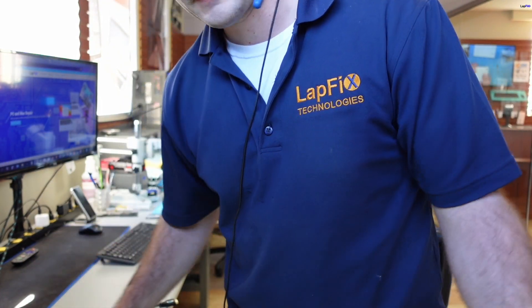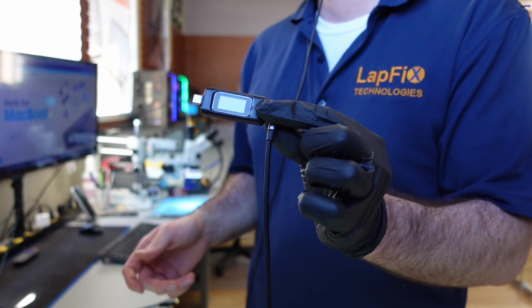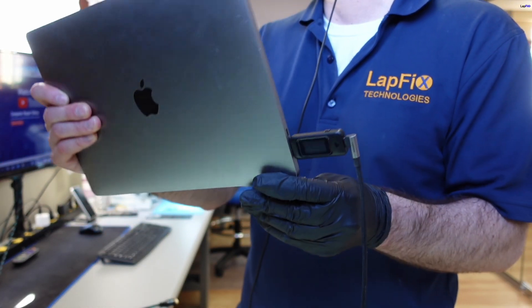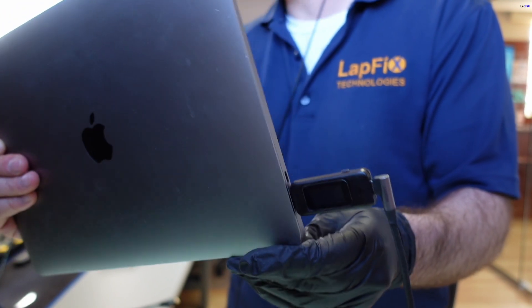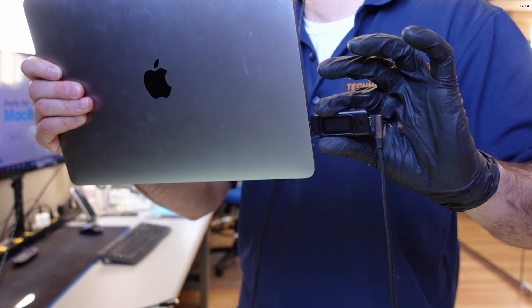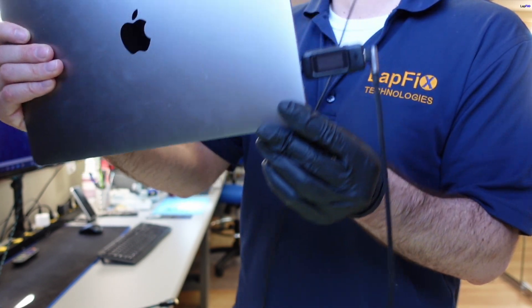I know there's a liquid spill but let's check the voltmeter real quick. I got this weird colored one — I don't like this one as much as the other one I had, but let's see what's going on. We plug it in... nothing. Completely dead. What do we know about completely dead? That usually means there's a problem with the port itself, maybe some type of broken connection, because nothing's going in — no voltage, nothing.